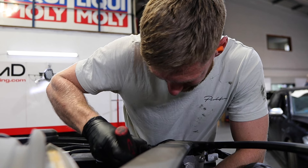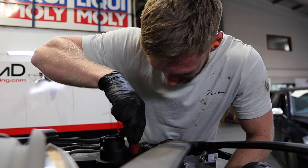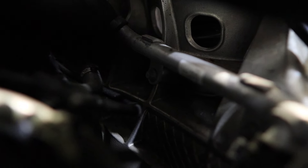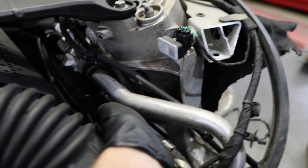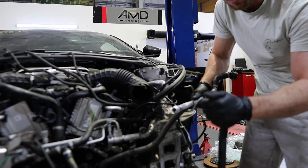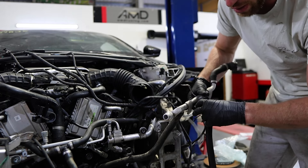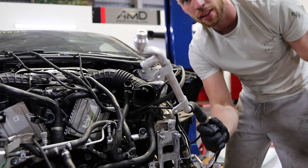Annoyingly, if this wasn't an Aston Martin there'd be a jubilee clip there, but unfortunately it's some kind of bunded ring of steel. So we've got to follow it a little further back and it goes straight into the expansion tank. Luckily there is a clip holding it onto the expansion tank so we don't have to buy the expansion tank as well. There's nothing I hate more than plastic connectors pushed onto plastic fittings using a metal clip - after getting hot and cold repeatedly they bond together and are a nightmare to get off. But luckily this is a 2019 car with low miles and the connector just popped off well easy. Supercar mechanics don't know how easy they've got it.